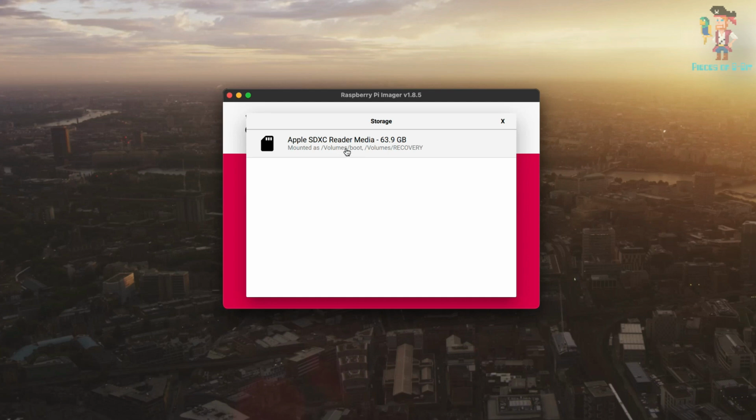In terms of picking SD cards, try and pick a reasonably speedy one. If you buy the really cheap ones, you'll just find that it runs really slow. So yeah, get yourself a good SanDisk or something like that. They're still relatively inexpensive. You don't need loads of storage unless you're putting lots of PlayStation 1 or PlayStation 2 games on, which I wouldn't recommend anyway. PS1 games are okay, but remember that they'll take up about 500 megabytes each because they're CD based. So they will fill up the space quite quickly.